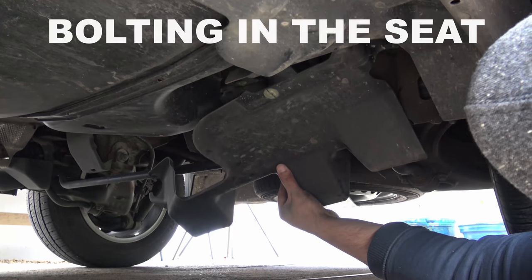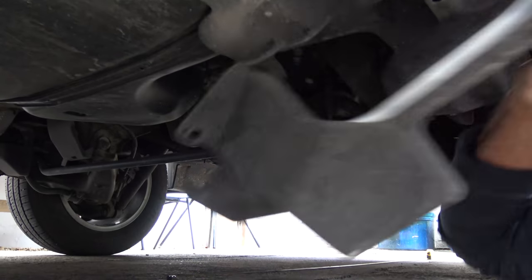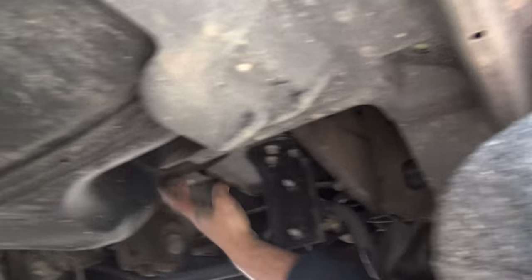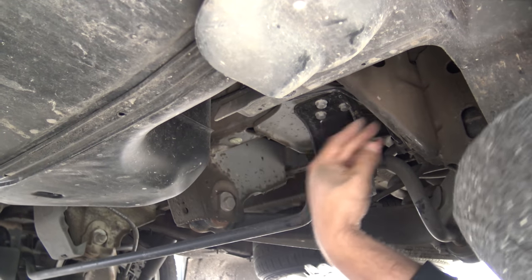So using an 8mm socket, you're going to have to remove this piece of plastic, a little bit of plastic trim from underneath there, because we are going to end up drilling through this cross member right here in a few different places. The other thing to note is when you're drilling and screwing your floor down, note there's a little screw there that pops out, so we'll probably get a bit of touch-up paint on that, make sure that we don't get any rust coming through.